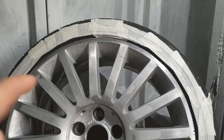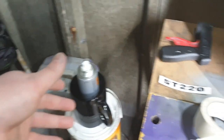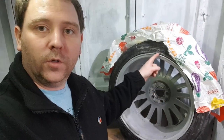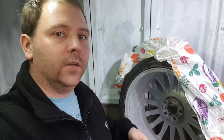I've started to mask up and I'm going around the edges with some smaller masking tape. I've got my filler primer sitting in some warm water for a better spray. I've spun the tire around and I'm putting masking tape around the back to shield off the tire. I couldn't find any polythene but black bags or newspaper would do the job. I'm going to start painting on the inside and then work my way to the outside.